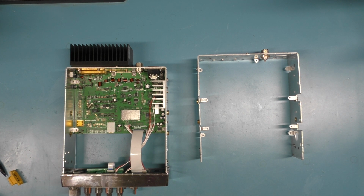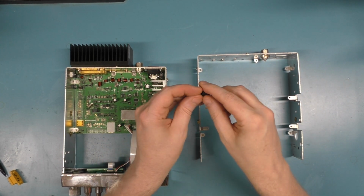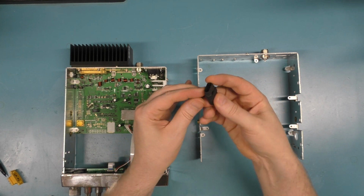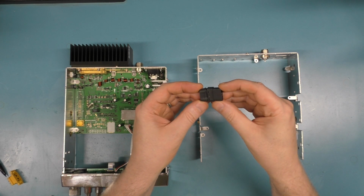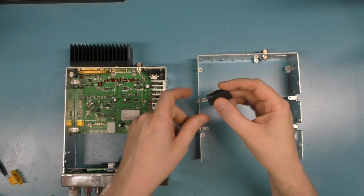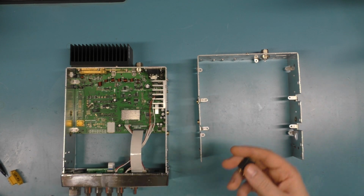I figured I would just throw this out there for all. These XT connectors are all over the place. They've got a little boot. You solder the cable in there and you put the little boot on it, and it covers up your connection. Maybe put a piece of heat shrink over it if that's your thing, and move on with life.